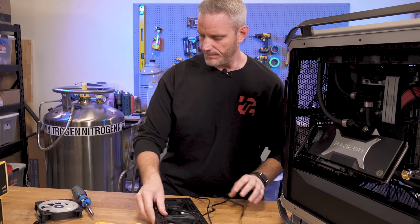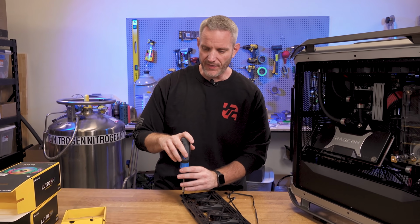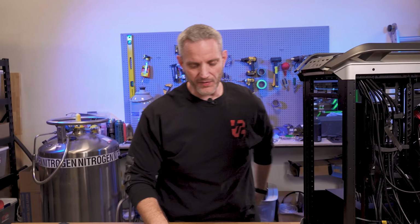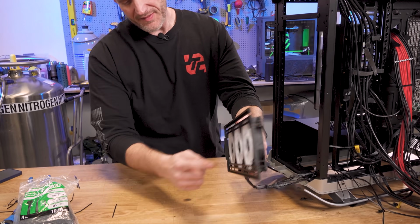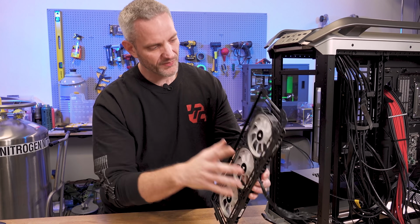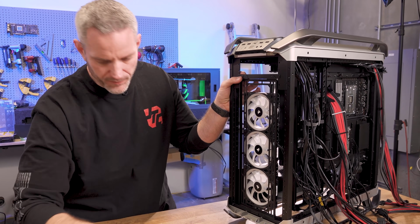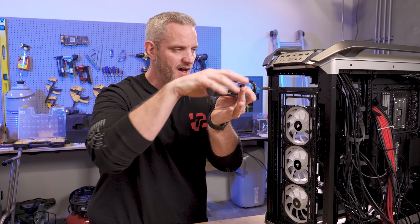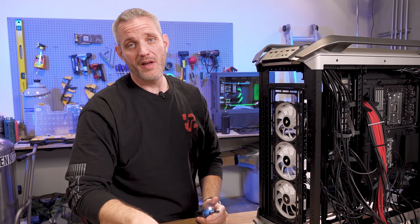So we're switching from 140mm fans to 120mm fans, which the only thing that kind of sucks about that is the fact that a little bit less CFM overall, but I think it should be plenty. The thing that kind of sucks about these fans, and yes, I know Corsair makes fans now that have the lights on both sides. I'm gonna see the glow off the rings. Remember, the light loop fans have lights in the hub and in the border, but when they're like this, I'm not gonna be able to see a whole lot of it. But I want all the fans to be uniform, like the same kind. I can't stand mismatched fans. Otherwise, I would have run the 360 on the top and then still run my 140 uni fans. But I cannot stand when fans don't match.